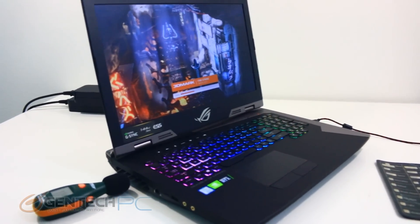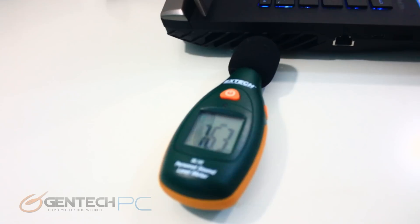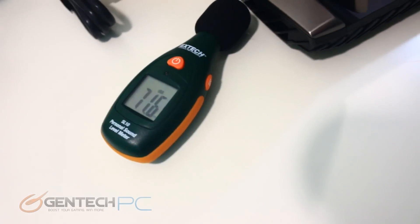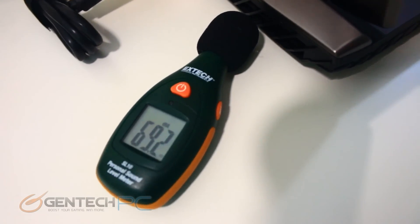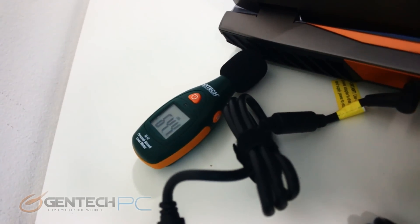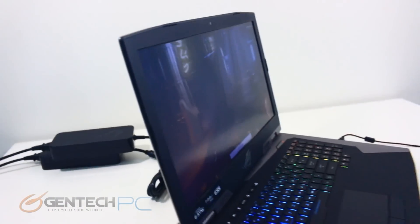With our benchmarks now underway, it's time to go back and check our baselines to see how they've changed. The sound levels have ramped up quite considerably — almost 76 decibels on the left exhaust. As we go to the back it's actually a little bit quieter, which may be due to the shape and size of the exhaust vents forcing air faster out the side. On the other side readings are also a little bit quieter, which could be how the fans independently spin up depending on which side is cooling the CPU or GPU.